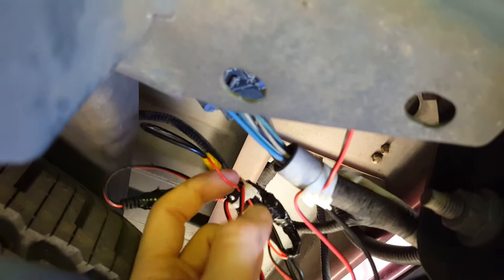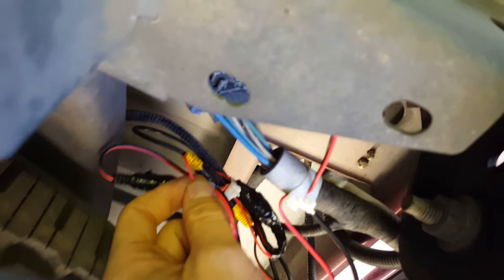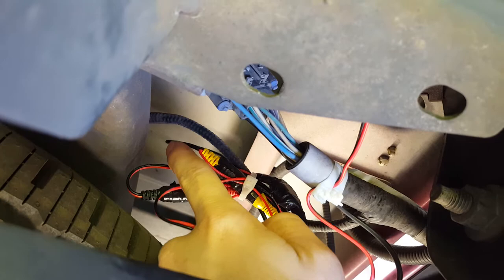You'll notice this is the tag line I was referring to — it has nothing connected to it, just a bare wire at the end. What I did was split the black and white down the middle, separated them, and connected right here with another quick clip, but I wrapped it up so rain and water wouldn't get to it. I used that red feed coming off of the video line and quick spliced it to the red 12-volt power from the brake light. This runs all the way through the black cable, up alongside the truck on the undercarriage, all the way up to the main cabin.